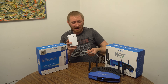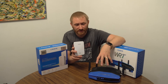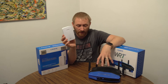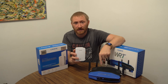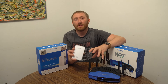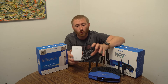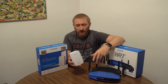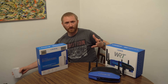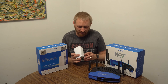I ran an ethernet cable from my cable modem over here so I can bump back and forth with the setup more easily. When you do this setup, you're going to want the extender in an outlet really close to the router — two reasons: it needs a really strong connection to pull all the data from the router, and once fully set up, you can move it to other parts of the house. They recommend within about five or six feet of the router.